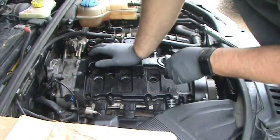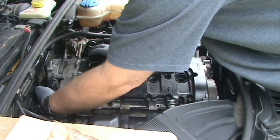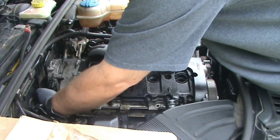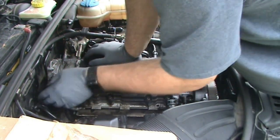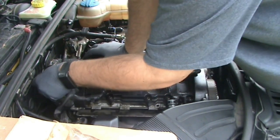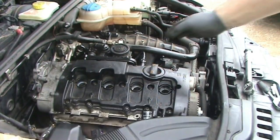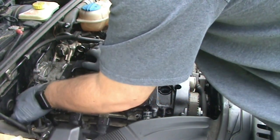Now that that's done and we have the spark plugs in so nothing's going to fall in there, I'm going to start messing with this harness. The bracket down here gets installed to the vacuum pump there. And once we have that done, we need to attach all these points. Actually, I'm going to torque that first in case this wiring harness gets in the way as I attach it. Now that that is torqued back there, we can attach some of this wiring loom up where it needs to be at.